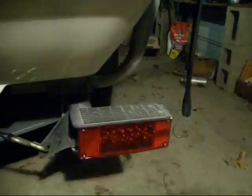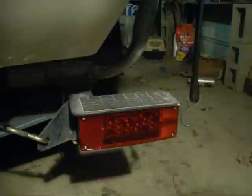In another video I showed I got some new LED tail lights for the boat from Harbor Freight — actually from Academy where they wanted about $56 but I got them for $40, saving about $20. I had problems with the old ones getting water in them — even though they were supposed to be waterproof, water would get in and hit the hot bulb, bust the bulbs, and cause corrosion. The steel socket holding the bulb would rust up and you couldn't get the bulb out.